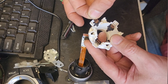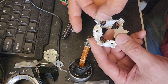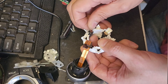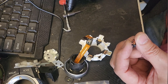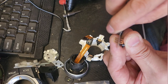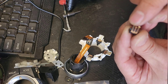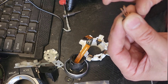There are two cutouts here, toward the center — these locking tabs go straight down into them like that. Before we stick that into the hole, I'm going to show you something. These contacts sometimes get really dirty because someone spilled something on them. Get a sharp razor blade and simply scrape the contacts to make sure they're nice and shiny. The middle pin is bent further inward than the outer ones — I usually bend them all out evenly to give better contact.